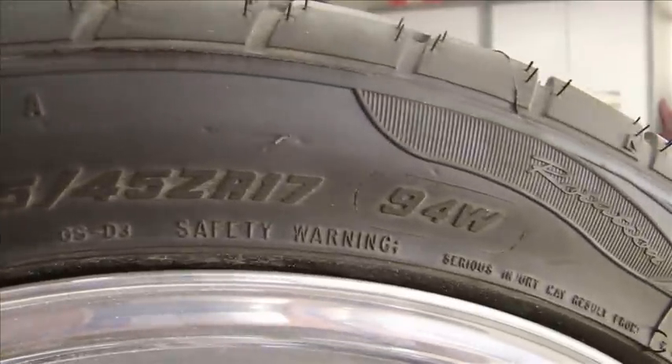Let me tell you a little bit about what to look for when you're buying tires. I want to focus on manufacturing defects. When you buy tires — whether it's one, two, three, or a whole set — tell the mechanic or salesperson that you want to look at all of the tires before they mount them to the rims. This is critical because the curing process brings out a lot of manufacturing defects, and if the inspectors miss it before it gets out of the plant, it'll end up on your car.